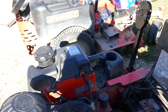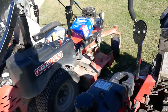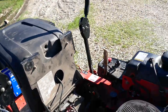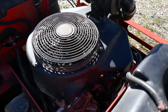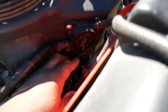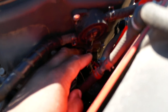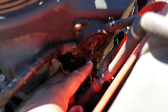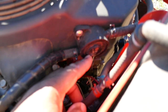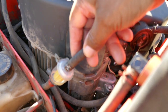What I came up with was this — if y'all are having the same problem, make sure that the hose clamps are in place. I was missing a hose clamp off the fuel line that goes to the fuel pump. I was missing this clamp here, so it was sucking air and making it run rough because I wasn't getting enough gasoline coming through the lines.